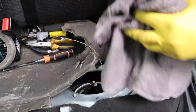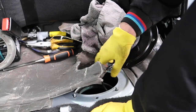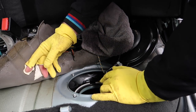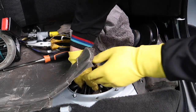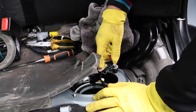It's not hard to get out — we've managed to get it out. We're now going to put the new one back in and plug it all back up to the connectors. The connectors are self-explanatory — you can't put them on the wrong way because they only go one way. So just make sure you grab them from here, fit them all on, and then slide the filter back in. Whatever you do, do not damage the float when putting it back in.